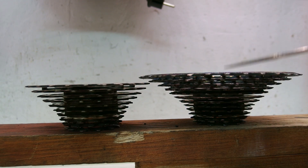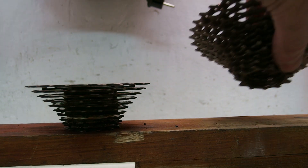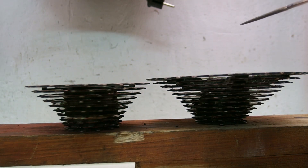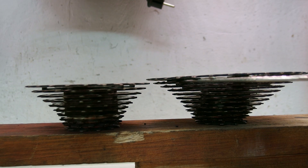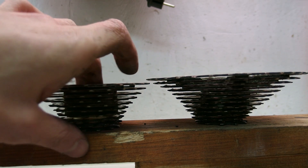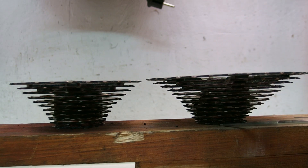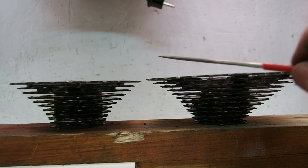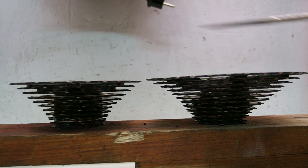This means 11 speed is most likely the most compatible of them all, and if you're trying to build some sort of weird mixed drivetrain, 11 speed is what you should be using. Interestingly, if we use the Sunshine 11-34 12 speed, the largest cog on the 10 speed cassette is flush with the 11th cog on the Sunshine. And if we put the 11 speed Shimano 105 next to the Sunshine 11-34, the width of both cassettes is almost identical — the Sunshine is just a touch wider — so they are not compatible, because there's one extra click, and this is going to work horribly.